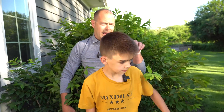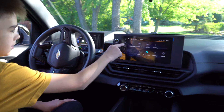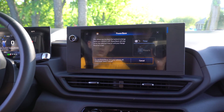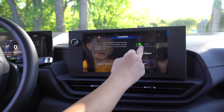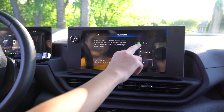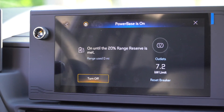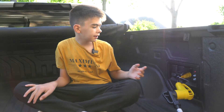Charlie is going to show us how we turn on this outlet inside the truck. So now that you're in the truck, you want to click on these two switches here and then go to power base. Click 'use power base.' Now you're going to want to turn off your vehicle — just take the keys and walk out of the car. You can also set up a timer so after, let's say, eight or seven hours, the truck turns off and stops powering your home. The power base is on now and it's going to let it run until 20 percent of the reserve range is met. Keep in mind, when you're running your home off of your vehicle, you're going to reduce your range of the truck.